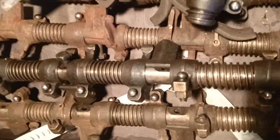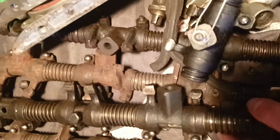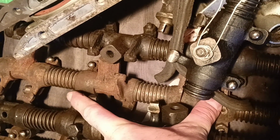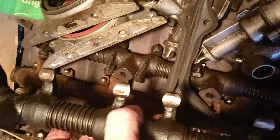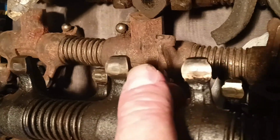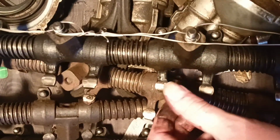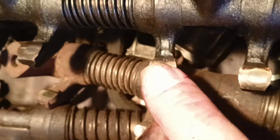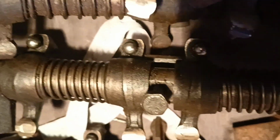And what I think about these rocker arms is it will be better to find ones with a good surface, not too worn. You saw that any of them was filed, and I prefer not to take them, because who knows how deep this surface was hardened at the factory. And if you file this surface, it will wear out faster after these procedures. I prefer to find them not so worn and continue using them, so you can adjust the valve gap. It should be adjusted with feeler gauges, so they shouldn't be too worn. There is no other way, only find good condition rocker arms.